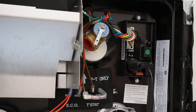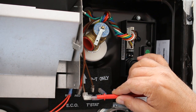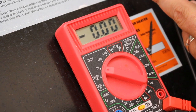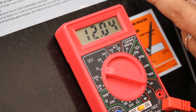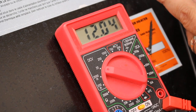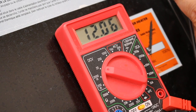We're going to take our positive wire from our voltmeter, stick it under the rubber here, and make sure it's making a good connection on that brown wire. Then take the negative from our voltmeter and touch it to ground. You're going to need somebody to flip on the gas switch and we'll see if we're getting power. As you can see we're getting power — looks like a full 12 volts, then it jumps up to 12.42. It's making its second attempt, now its third attempt. We're getting power to that brown wire.